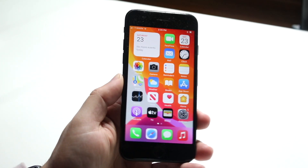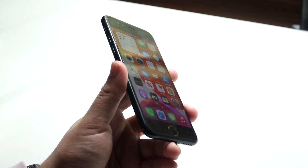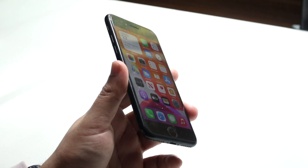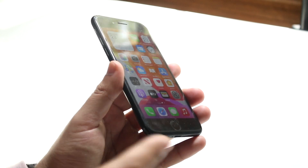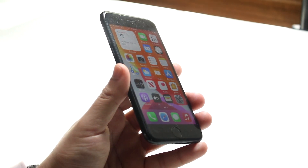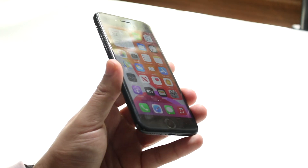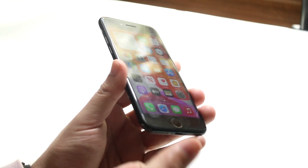The first thing I would highly recommend is to look specifically at that Touch ID sensor and see if there's anything blocking it. You may want to check if you're wearing gloves — you need a strong fit for Touch ID to work. If it's being blocked for some reason, wipe down your Touch ID sensor. Maybe there's some water or sweat on it. Wipe it down and then try again.